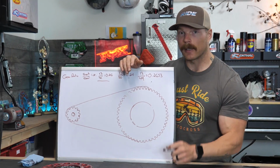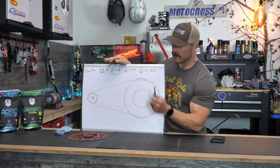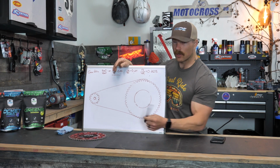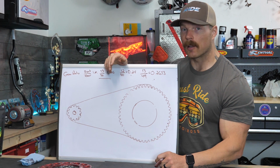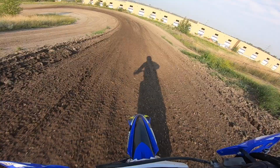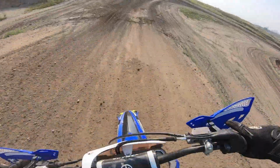Now you're probably asking, does it really make that much of a difference? Because remember here, when we did our calculations, 0.26 to 0.2653, it's not a huge swing. You might be thinking, well, why didn't you do one in the front if you really wanted that much of a change? One tooth on the rear sprocket completely changed the way the bike handles in corners, powers out of them and stuff. You'd be blown away by how much one tooth on the rear can change. One tooth going down on the rear completely leveled out the bike for me.